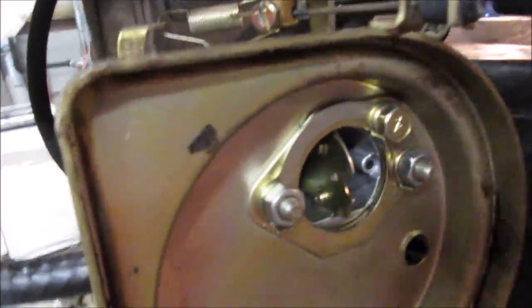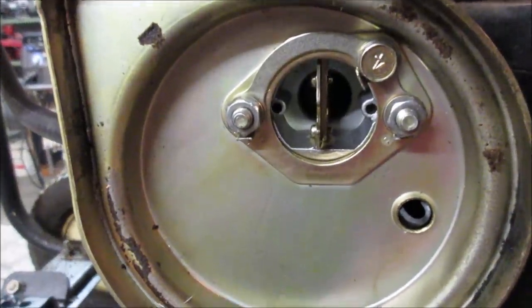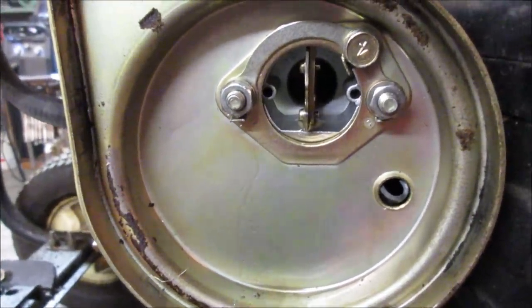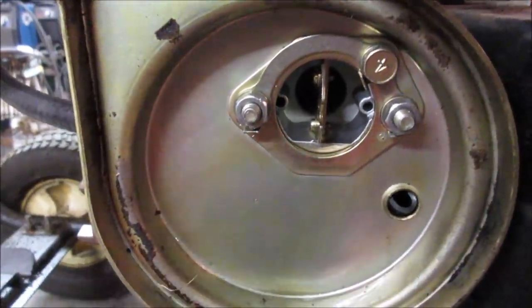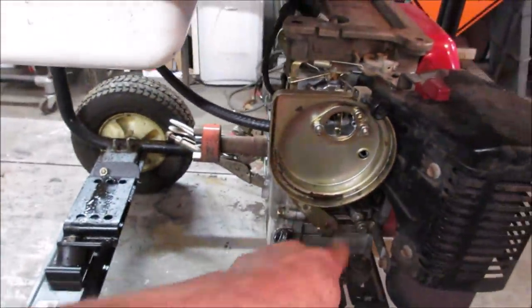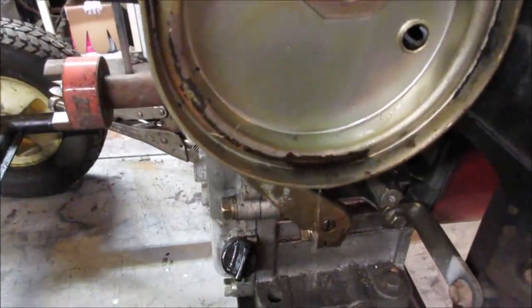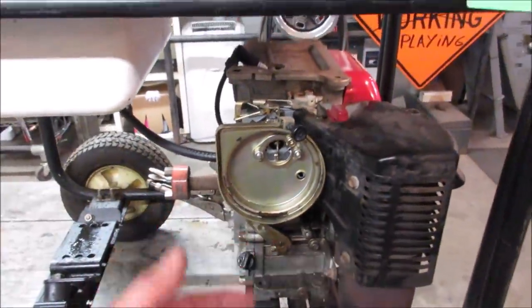That's weird. Check that out. Can you see the smoke coming out of it? Don't know if that carb is flooding over. You see the mist. Yeah. It's dripping. Hate when that happens. I'm gonna go pinch off the line. I'm gonna go drop the bowl again.